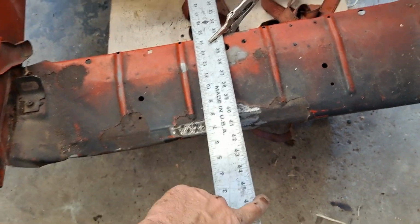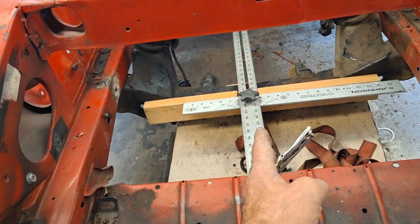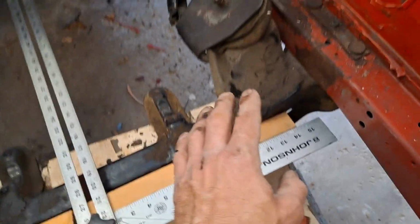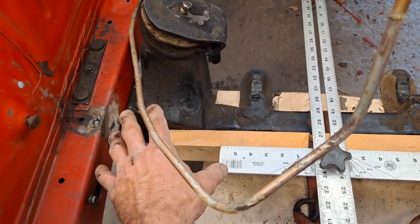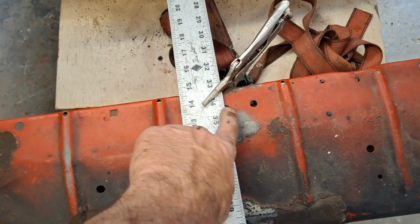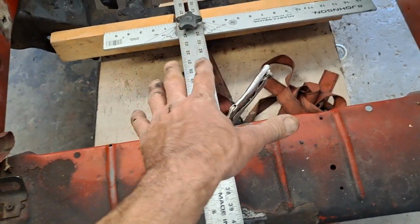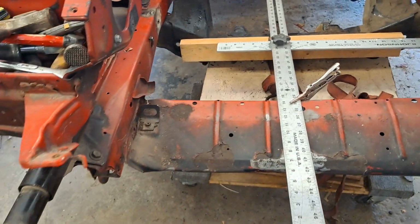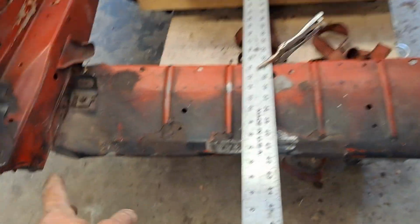This line of the framing square, or my drywall square, is the middle of the car. And I've been taking measurements off the frame rails, off the subframe, just everything. I've been going through and marked it out, center lined of this hole, hoping that is good. I know this is square. I've used it many times. It actually is very square. So I've been doing all the measurements, and we are actually in really good shape.